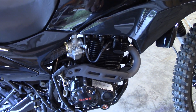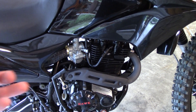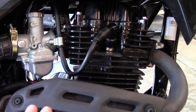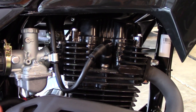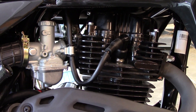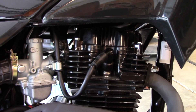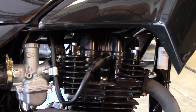There's a lot of discussion about the specs, but the key is they don't want to be too tight. It's better to be loose than tight. We usually go a little bit higher on the exhaust valve since it heats up so much more — give it a little more room for expansion. You can go up to about 0.004 or 0.005 inches on the exhaust, and 0.002 or 0.003 on the intake.